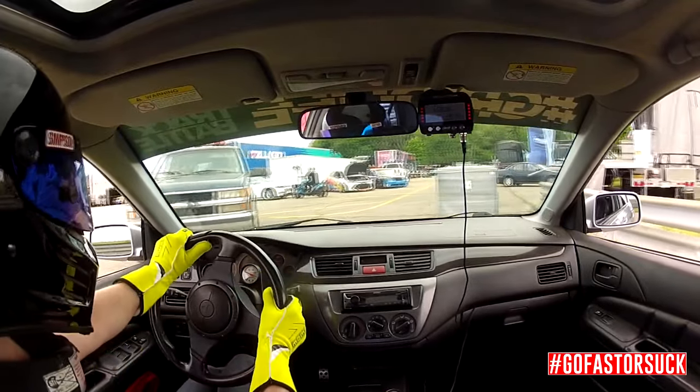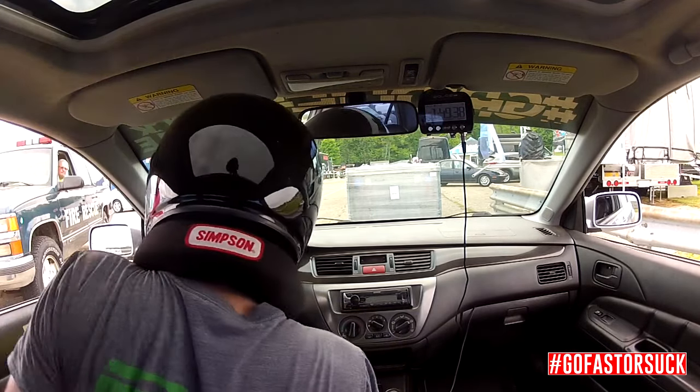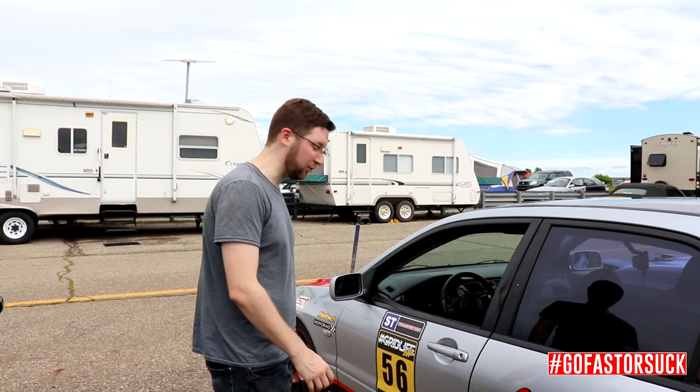Intercooler pipe. Yeah, intercooler pipe. So I've got some sort of issue. I've got an ABS light, and after I drive for a little bit, it throws an active center diff error. Error codes are 26 and 65, which are wheel speed. 26 is a wheel speed sensor code for an unexpected signal, and then 65 is an ABS control code. I don't know what's going on. It might be an ABS module. It might be that there's actually a wheel speed sensor issue. I don't know. I'm just gonna look over the car and hope I can find something, so.